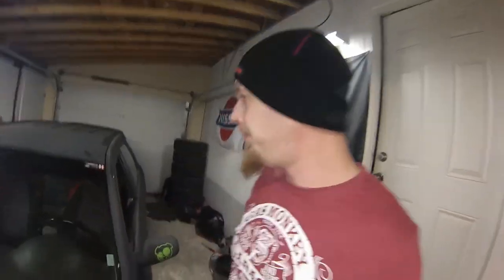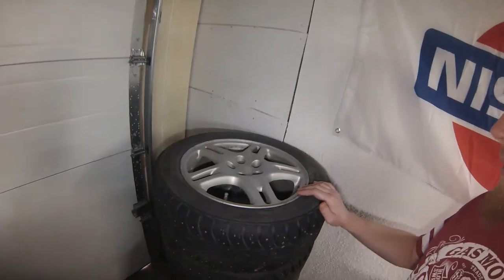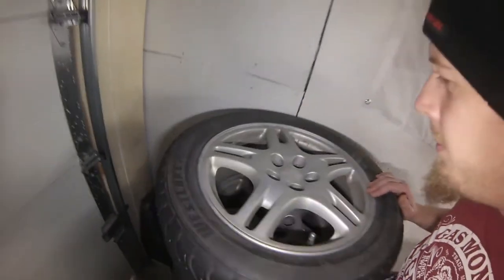The entire ABS system has been completely eliminated from the car. All new lines have been basically routed through the entire car, as well as stainless steel brake hoses at all four corners. As for winter wheels, which will be coming up soon because I probably will drive this car at some point in the winter after they get the exhaust put on it, I have 16-inch WRX rims